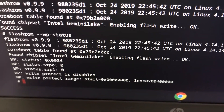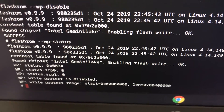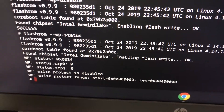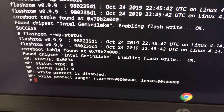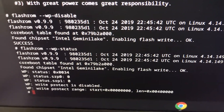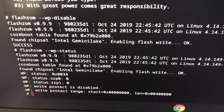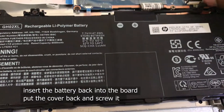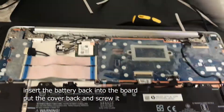That is how to disable write protect on a Chromebook without the write protect screw. If you have a Chromebook with the write protect screw, put your Chromebook into developer mode and then unscrew the write protect screw. If yours doesn't use the write protect screw, follow the steps in this video to disable write protect, then put the screws back.